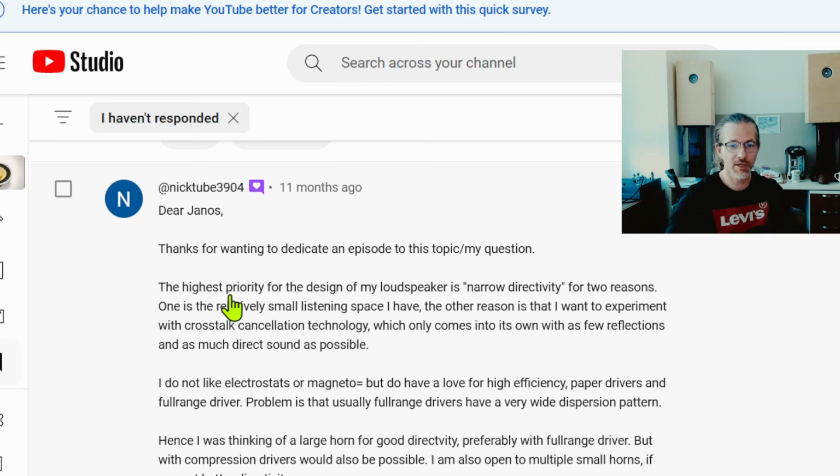that is of a smaller size, and he says, the highest priority for the design of my loudspeaker is narrow directivity for two reasons. One is the relatively small listening space I have. The other is that I want to experiment with crosstalk cancellation technology, which only comes into its own with as few reflections, as much direct sound as possible. So we want, in a smaller space, as much direct sound with as few reflections reaching you from the room itself as possible,